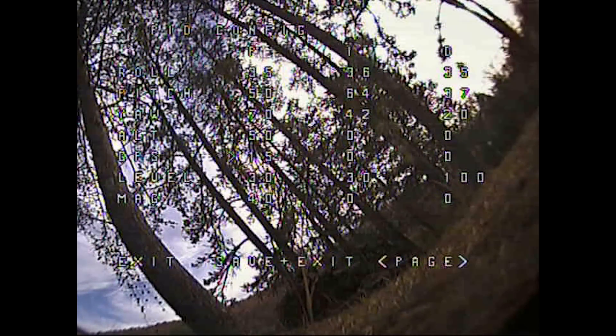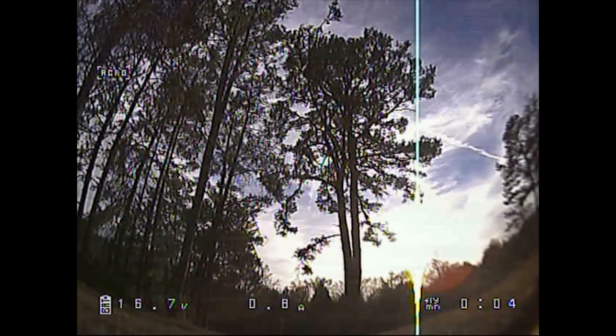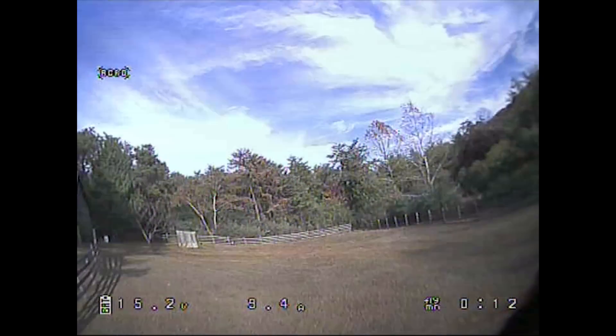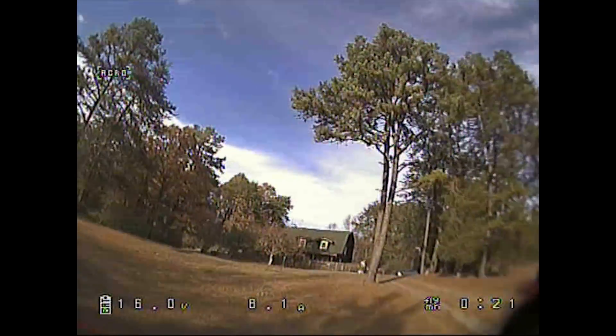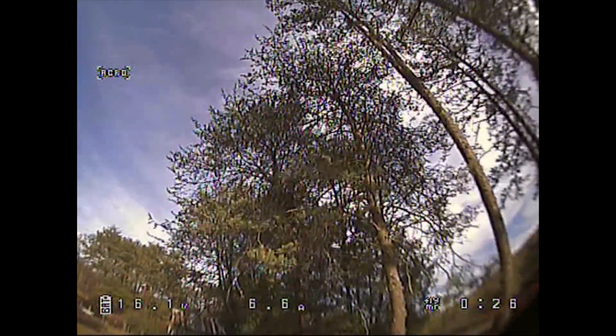Let's see what we got here. Let's take those D's up and see if that improves things at all. I really feel like that stuff is pretty solid. The motors aren't shuddering on the ground — that's good. There's that little shuddery, crickety oscillation. That's excess D-gain and it needs to be stopped.